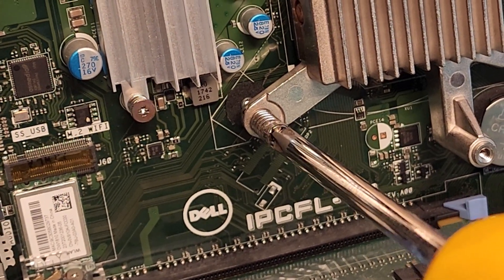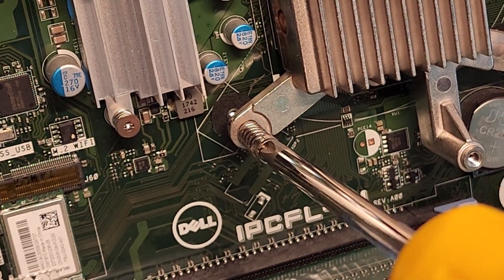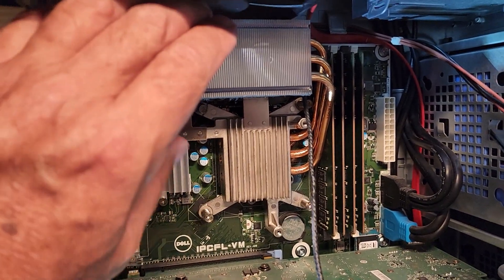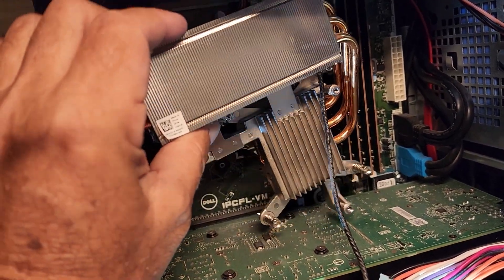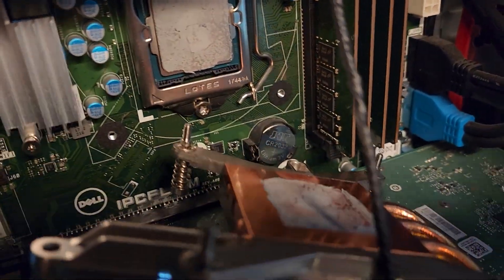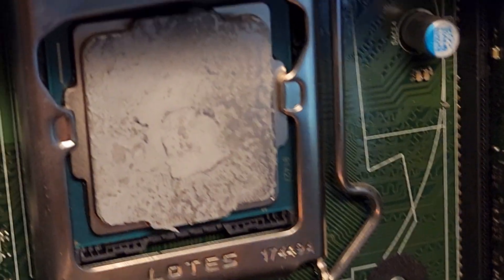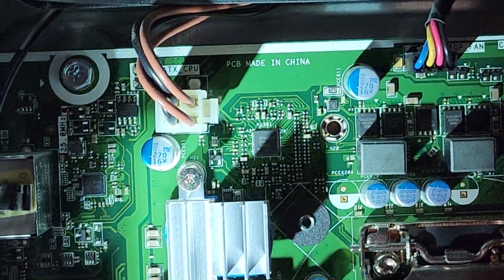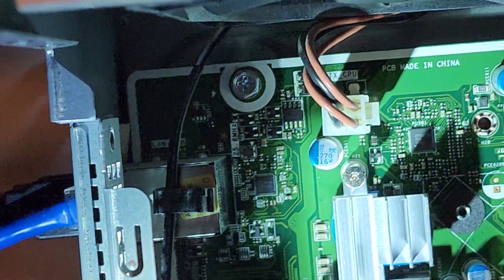Thermal compound eliminates the airspace between your processor and the cooling heatsink that goes on top of it, to make sure heat is conducted away from the processor — that's why the fans and fins are there. I just turn it counterclockwise until you hear the thread kind of pop, then the whole thing should come out. Watch out — there's a cord going through there from the fan, they routed it right through it. Look, there it is. There's thermal compound right on the copper and it looks like they put plenty on — 100% coverage. And I notice the brown and black wire going to that little four-pin clip right there — that's why I had to pull all this stuff apart just to get to it. How annoying.